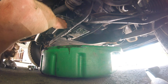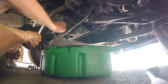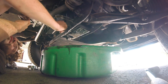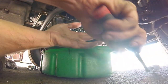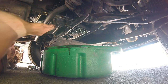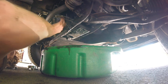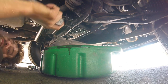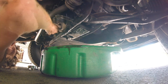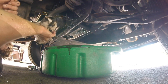For reference, if you go to a quick oil change place, they're not waiting for that thing to stop dripping. I'm not saying that's good or bad — I'm just saying they're not going to wait. And some of those places actually suck out the oil; they don't even pull off the drain plug, they'll suck it out from the top. So a 15mm socket — we don't want to kill this, just snug. I'm going to take my rag again and wipe all around here so that when we're running, I can get under here and do a quick visual and make sure we're not leaking.